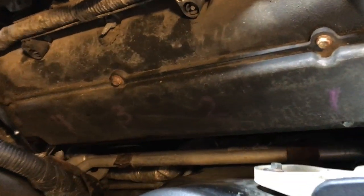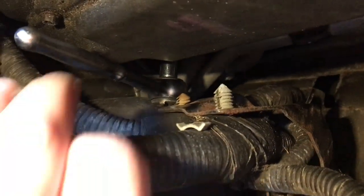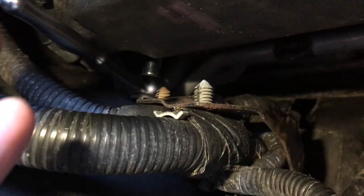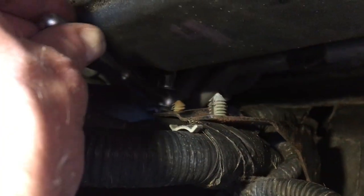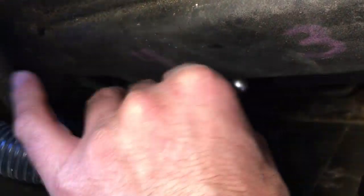Most of the cylinders on the left side are pretty straightforward to get at except the one in the back — you just kind of have to work at getting your wrench down there. There's some foam padding with a little give, so you need a short socket, not a long deep well, otherwise you can't get it in there. Once you get it on there, break it loose — I'd recommend coming from underneath with your hand to get it started. Once it's significantly loose you can maybe get it with your fingers. Take all these out and you can get access to your spark plugs and your coils.